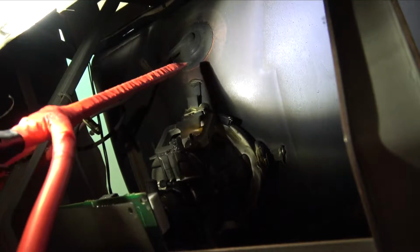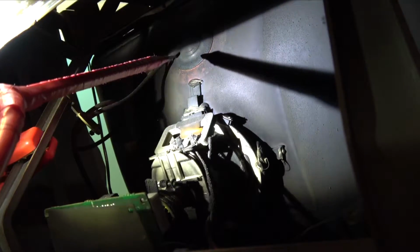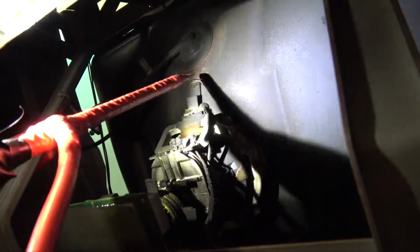Okay guys, so we're ready to just take this anode cap off, and I'm just double checking to make sure the earth is on there, and I'm on my haunches here, so I've still got rubber soled feet going to the ground. Make sure I don't touch anything else around here at the same time. Put that under there. And off it comes. And we can just double check the screwdriver in there. Make sure there's no charge coming out of there, so we're all safe.